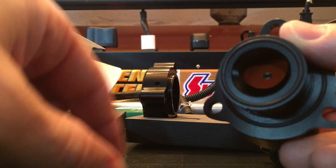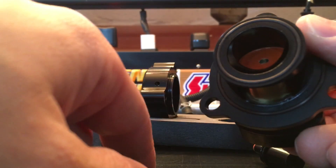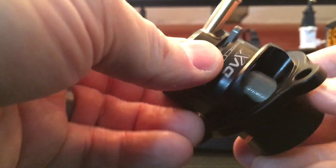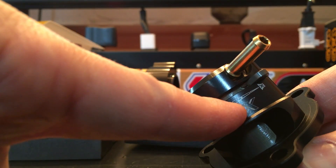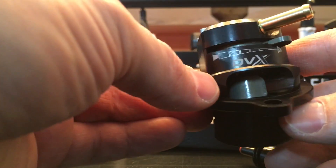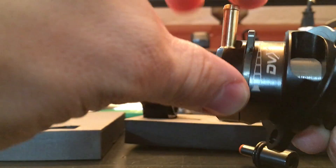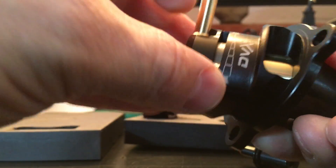The main unit has a port off the top and a VTA port here, as you can see. Underneath it's a canted design — that's where our main brass plunger with rubber face was, and it feels like the main spring is still in there. It's a little bit of a different design, not exposed like it was in the original DV or DV plus. On the front side there's also a gauge, and the goal is that it's a dual-port design so you can have recirc, vent to atmosphere, or a combination of both.